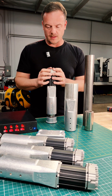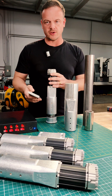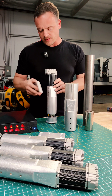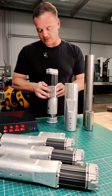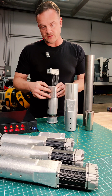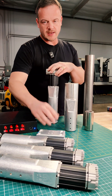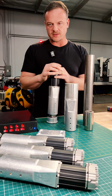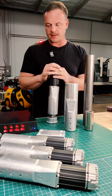What makes that unique is that the billet construction is really good at transferring the vibrations or the haptics back to the driver. So once you mount the bracket to the actuator and mount this to the chassis, it is able to really transfer a lot of the high, low, and mid vibrations back to the chassis and back to the driver, giving that feedback and information.